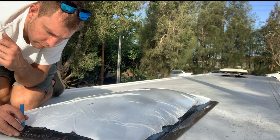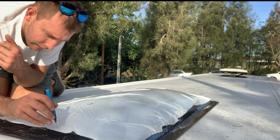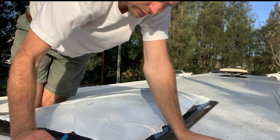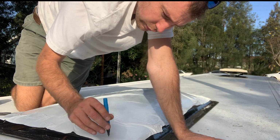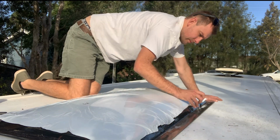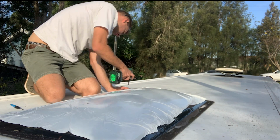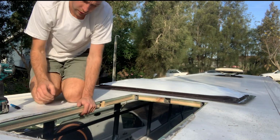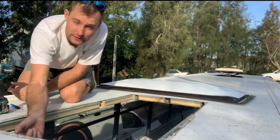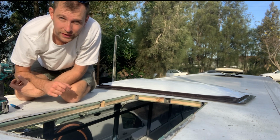And now I'm just going around with my Sharpie now that we know exactly where we want it. And we are going to be able to pre-drill through the sheet metal. I'm just going to go where the timber is, because on this back side we are actually utilizing the hoop that is in that location, so I'll be using self-tapping screws there, so I'm not going to pre-drill that spot.